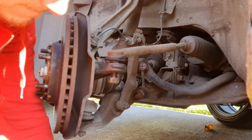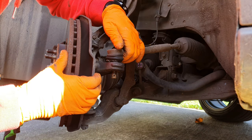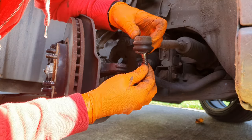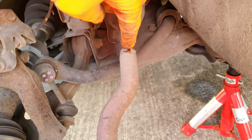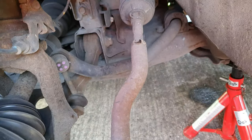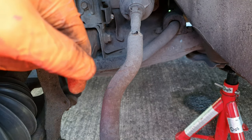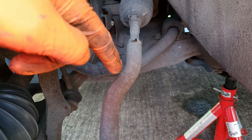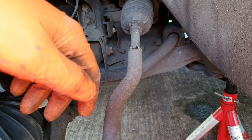Get a hammer and it's done. Remove it — look how bad that is; you shouldn't be able to move it like that. I need to clean all this dirt off too. Do not loosen this lock nut too much because you need to count how many turns it takes to remove the tie rod end. The reason is: when fitting the new one, you need to match the same number of turns. This is all about your wheel tracking — if you don't count, the tracking will be way off. At least this way it won't be too bad to drive to the garage.